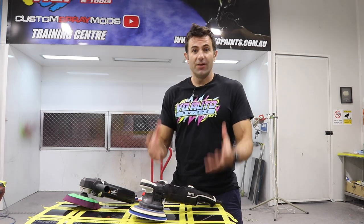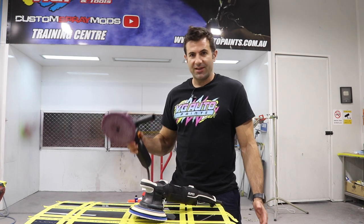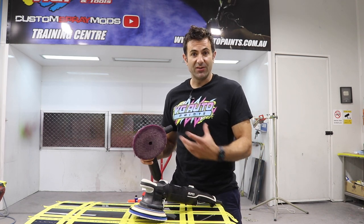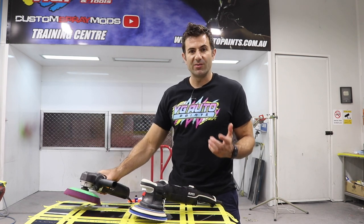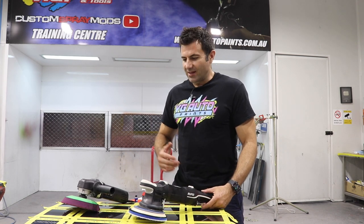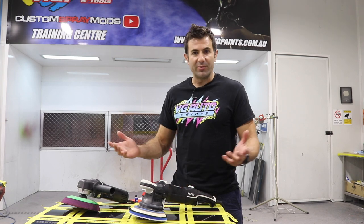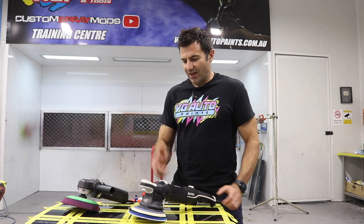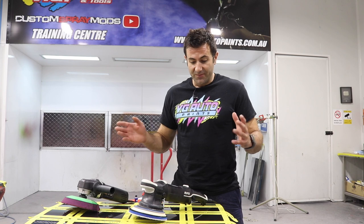I hope that video helped clear up a few misconceptions about different machines. Definitely if you are taking on some detailing work or planning on getting serious about it, I would definitely get a rotary machine because it can make your job a lot quicker - you never know when you might come across some really heavy scratches and need to do some sanding. A dual action machine, you can get really cheap ones that will do the job and correct the paint on a whole car, apply ceramic coating or any kind of coating. The clear coat is a lot stronger than you think, so hope that helps you next time you're doing some detailing.